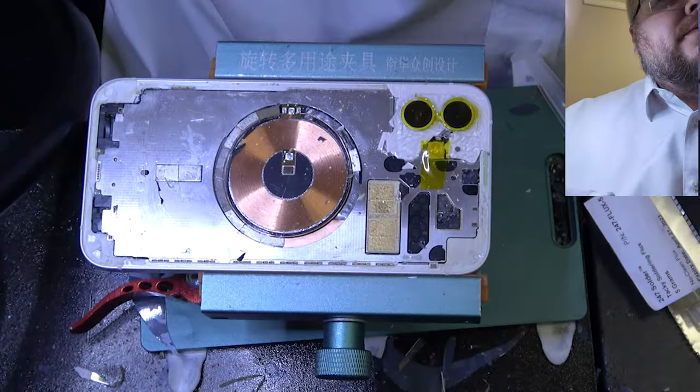I'll take the glue off of the 5G antennas very carefully, because it might have some glass shards, and then I just use T7000 to re-glue it. There's no glass shards underneath anywhere. They need to be all out so that the new screen, new back glass will fit on properly. You don't need very much heat to remove the glue.